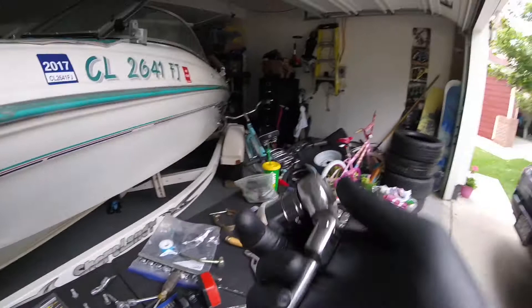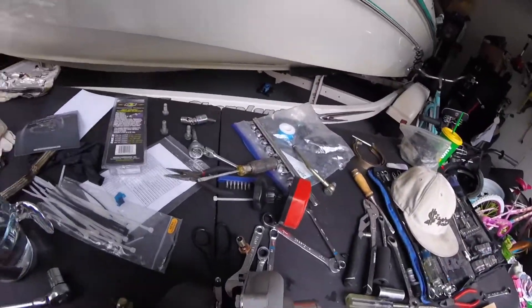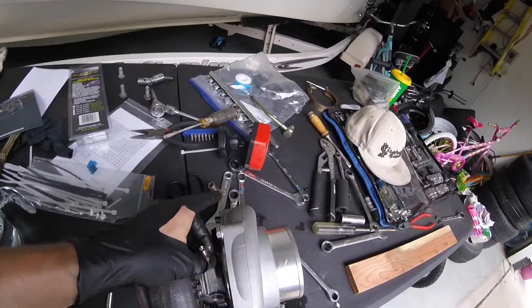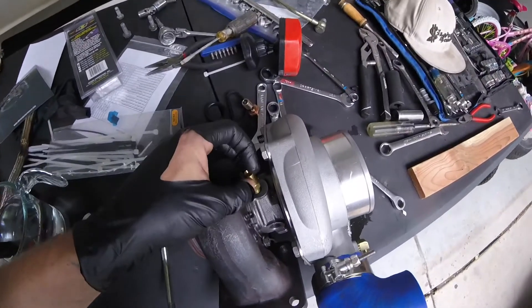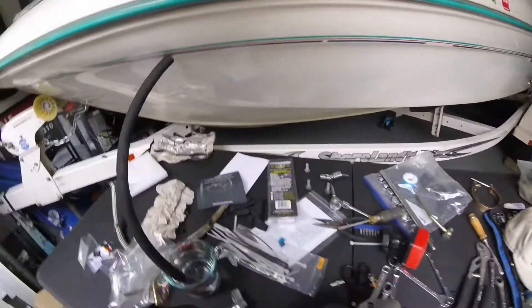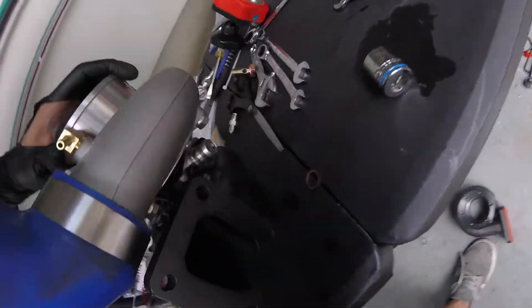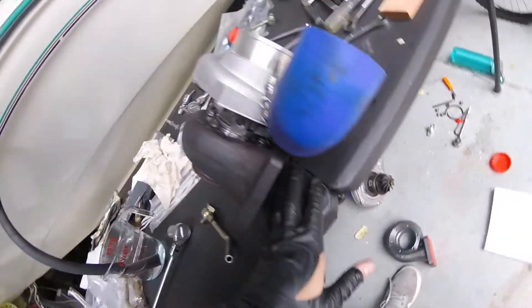I did also have to find this special hinged socket which allows me to cock it just a little bit and I can get it on that coolant line so that you can get that coolant line nice and tight, which was a challenge. Also, different oil restrictor up top here - I did get a new one. This is a Precision Turbo one. This is small enough to allow me to fit a socket on top. If you recall with the CX Racing restrictor, it was so big you could not get a socket around it to properly tighten it or the oil feed line. I also slightly ground down the flange right there so that I could properly tighten the exhaust housing bolt.